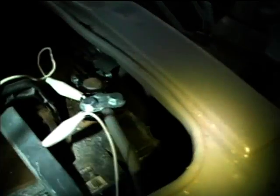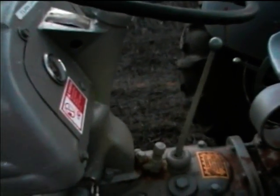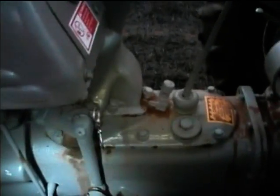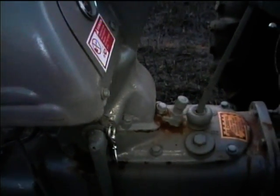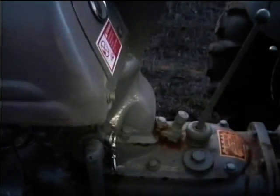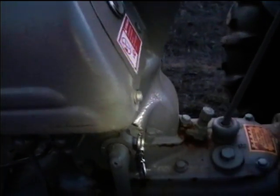Here's the quiescent state battery voltage of 12.9 volts. What I found is I had to hook up the field coil wire to the alternator. I'm not sure if it's exactly a field coil, but it's something that has to be energized when the key is on in order to make the alternator work. It may be the field coil or it may be something going to the internal voltage regulator.